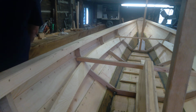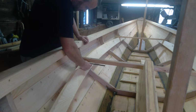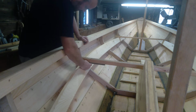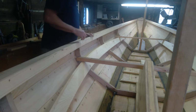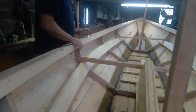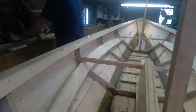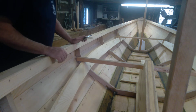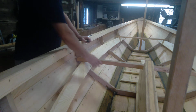So the next thing we want to do is make sure that 2 inches beyond the seat riser is not going to be further than the side of the boat. So 2-inch overhang is fine. We've got another 1/2 inch. Alright, well, I'll snag another bevel square. So we've got that angle. Now the next angle we need is the angle that we're cutting the seats at.